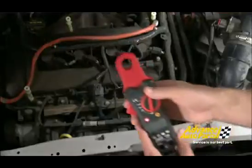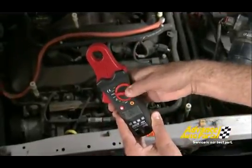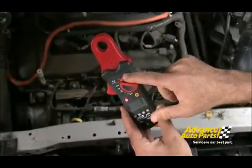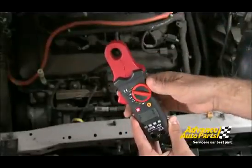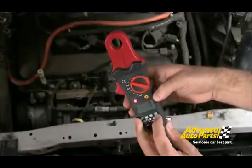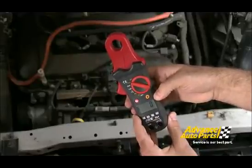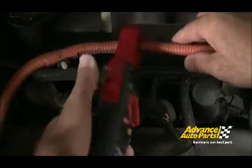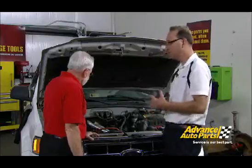For this test, I'm going to set the meter to the 5 amp range. There's a 5 amp range and an 80 amp range, and for this wire — which should be 4 amps or less — we should be safe there. With any DC current probe, you want to zero it first before you clamp over the wire, so we're going to do that. Then I'm going to clamp it right there. We should be good — go ahead and start the vehicle now.